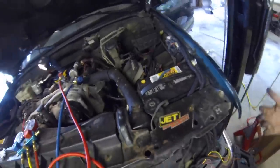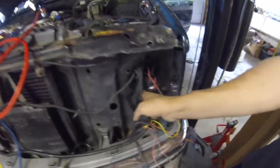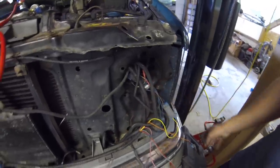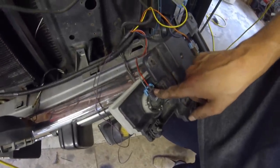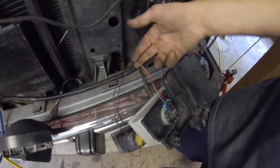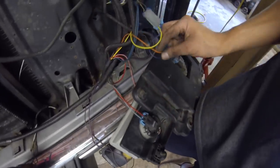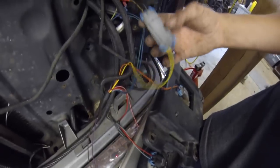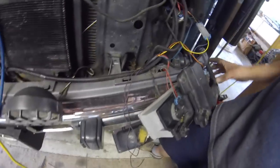The second harness — really the last harness — is the headlight harness, which is really simple and looks really scary. You have your headlight plugs. This comes out of your harness that you just installed. This goes directly into your headlight, and so does this one. Then the harness has these little things where you plug your old ones into, and then you're done.